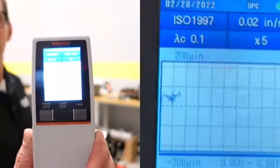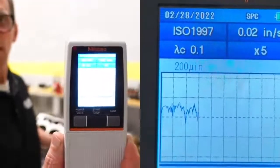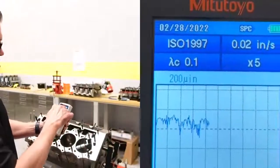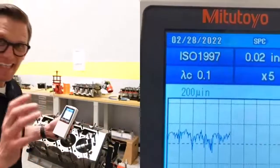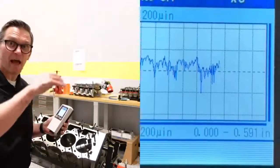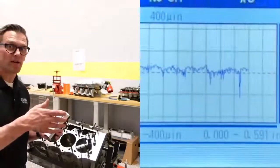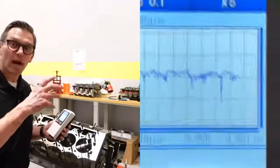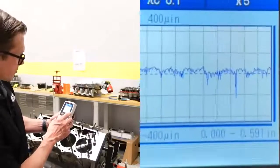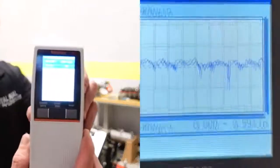You can probably see that on the camera — I'll be rolling over the cylinder trace. What you're seeing already are these irregularities. That's the key: because if there's any kind of corrosion, it's going to create these little peaks and valleys — not the peaks and valleys we want from the honing process. These are very irregular shapes, and this one looks like someone took a dump truck and backed over that cylinder. It is so bad.